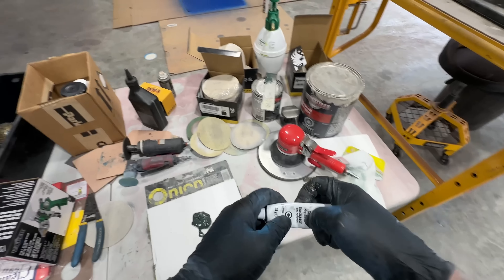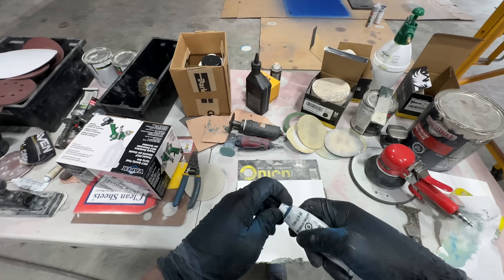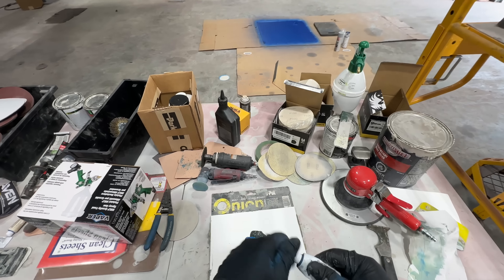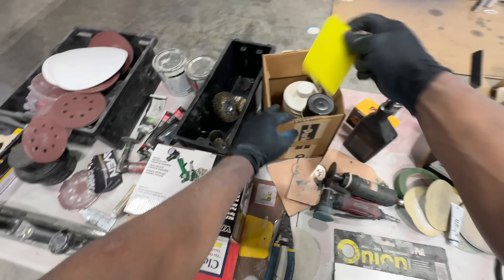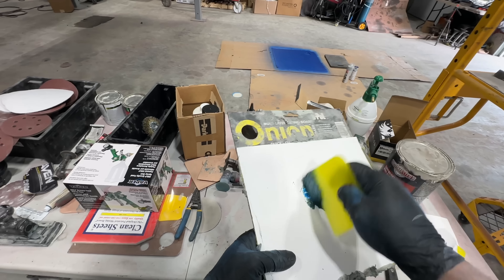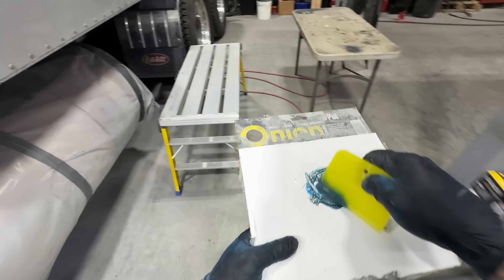With cream hardener, you want to add enough that it actually hardens. But the more you add, the faster it hardens. Plus this stuff ain't cheap — about eight bucks for a little bottle. If you've got a little patty of filler on there, I usually just put a bead right across it and that's more than enough. I actually got myself some metal spatulas — I was watching some professionals on YouTube and they had these metal spatulas and just kind of work the filler and mix it up that way. So maybe the next time I mix up some Bondo, I'll use that.